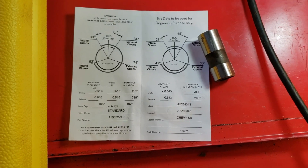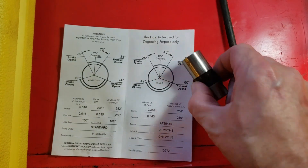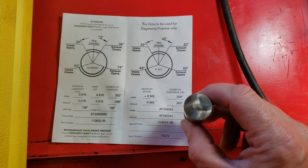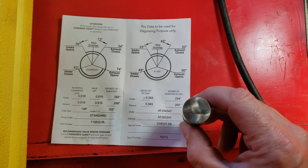I'm running a Howard's 91118 lifter. It's got a 21 thousandths hole in the middle of the lifter to oil the camshaft. I did this because I planned on street driving the car.